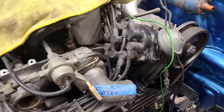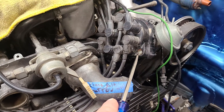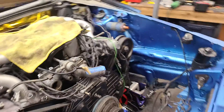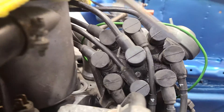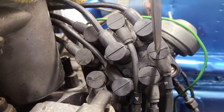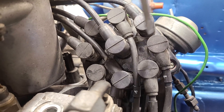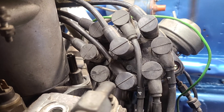When you're doing your timing, there's one more thing to check. You can pull the distributor cap — these are actually numbered. Right there at the tip of the screwdriver is number one. If you pull off the cap, the rotor should be pointing to number one. You can also make sure that the rotor is pointing to the little notch in the distributor.